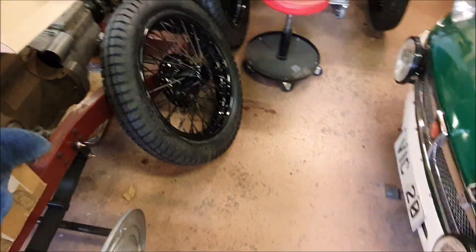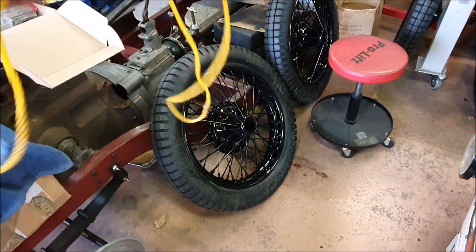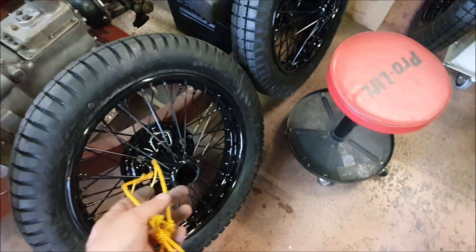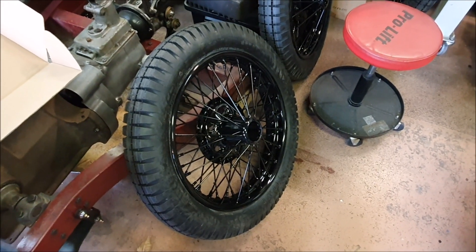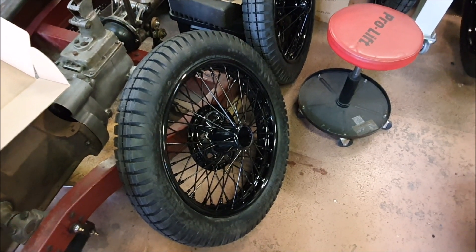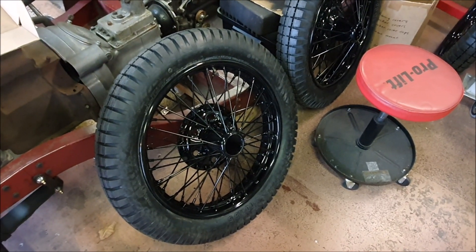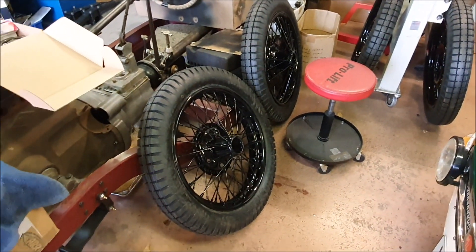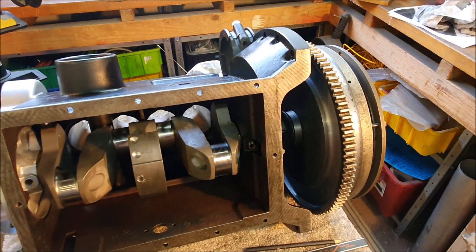For the wheels, I decided the best way to fix them was to make a garrotte tool. I set the wheels flat on the ground, looped it behind the spokes and gave them a little tweak — it turns out most of them weren't really that bent, so they're all straight again now. The wheel builder chap is going to send me some paint so I should be able to touch up where the paint's been damaged — rub it back a little and touch it up with a fine high-quality brush. They should be good. I'm going to look into the best way to sort out the inside edge of that bearing bush.